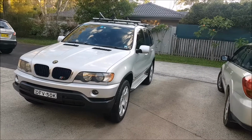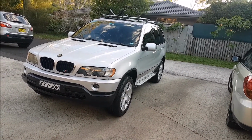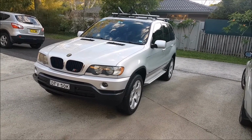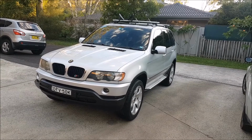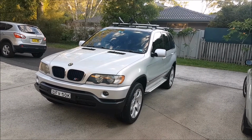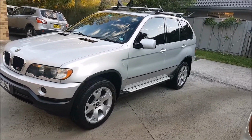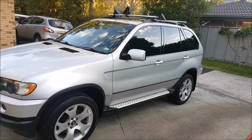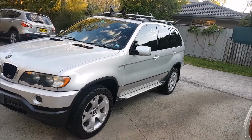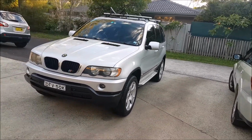So I did what I normally do, the pre-wash. Then did the foam using Bilt Hamber car foam, and then used CT18 to wash the car. And then I did a three-stage decontamination, that being iron remover, tar removal, and clay bar. So I used the Zentil clay bar, I think it is. It's a pink one, fine, using Car Pro Imalube as the lubricant.